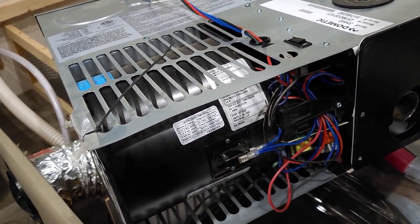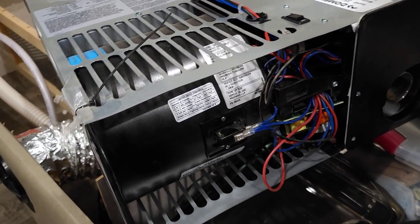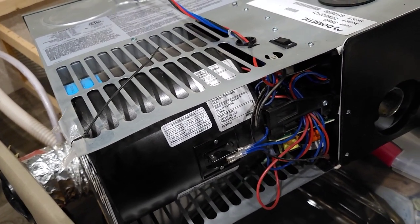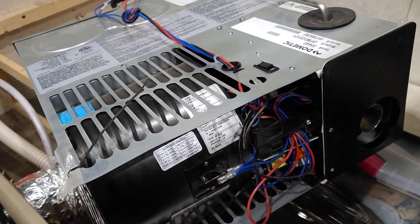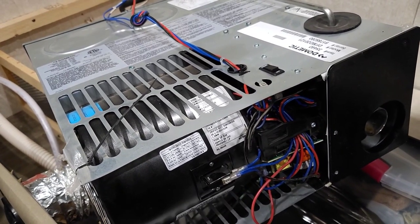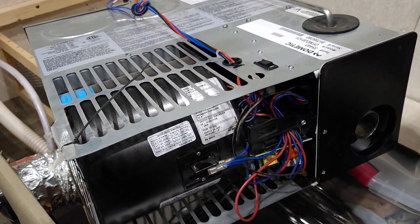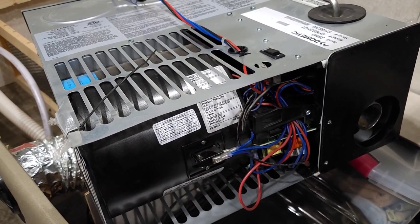Take these two screws out and then have your wife or somebody turn the heat on and make sure it actually fires. My sail switch wasn't bad, it was just dirty. It takes 10 to 20 minutes to remove stuff to get to your furnace on these Jacos because they don't have an outdoor vent, but you just take off the four screws outside on the vent, pull a couple screws to take your couch lid off, then a couple screws for the little box, and twist your little vents off. The sail switch is right here — I just took these two screws out, cleaned it out, put it back in, and now I'm going to install the furnace and put it back where it goes.